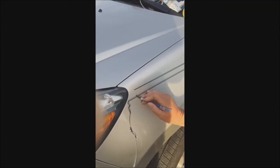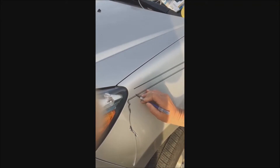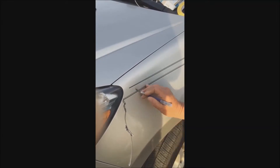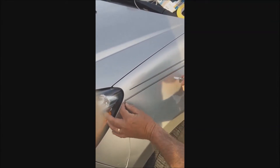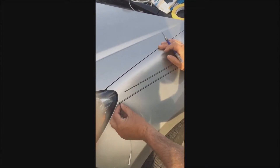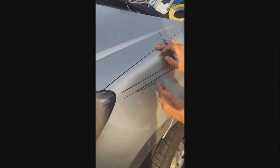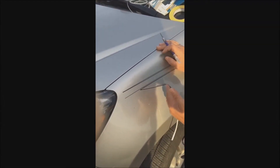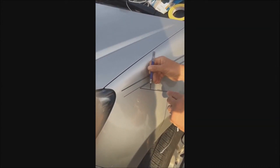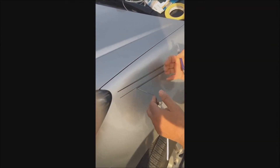So this is how we do it — I cut the top line. I'm just going to press the rounded blade and you can hear it almost click, or you can just feel it gliding through that vinyl. So you don't cut the car. I cut the top line, and remember both lines — the clear carrier is still on this. I'm going to come back now gently and pull back two or three inches, whatever you want. The carrier keeps the vinyl piece from stretching on a warm day, otherwise it'll stretch and you don't want that.